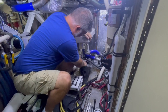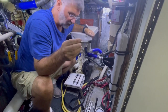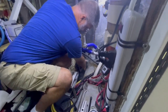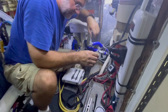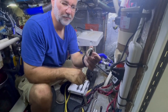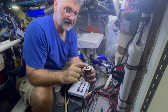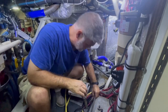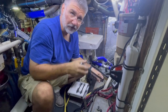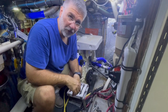I've taken off the power takeoff pulley assembly, which was held on with four bolts. Inside the vibration dampener there was a three-quarter inch bolt with a huge, super thick washer that holds on the vibration dampener — so it's a three-quarter inch socket that holds this on. I simply used a breaker bar and it was two quick pulls and it broke loose, so each time I replace this, getting that bolt off has been very easy.